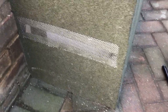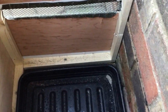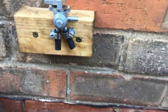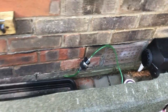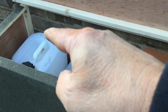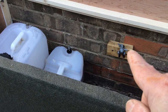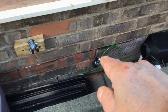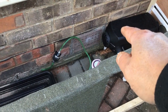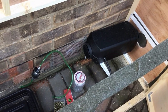I've now put that on - mice are not going to get in there. I've moved the tanks up to this end. That will now be there coming into the boxed-off section. There's the three-way valve, and the fuel pump is down there. The two feeds - that one should go to this one and that one can go to that one. This top one feeds out down into the pump, and the pump will then feed over the top of the inlet pipe underneath. That's the fuel inlet - I'll give you an update when I've done a bit more.